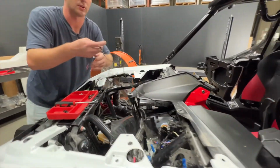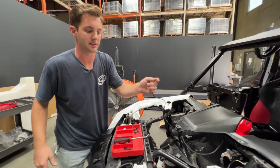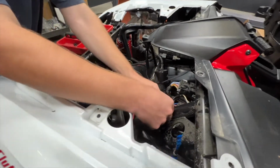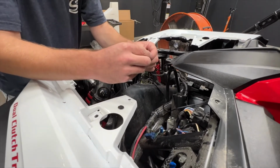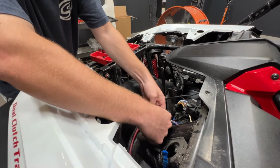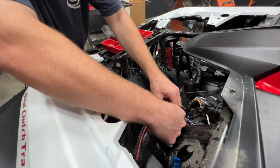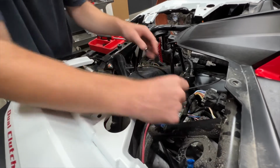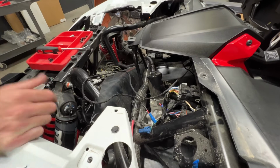And grabbed it out up front here. And so we'll cut and strip this end, and it's now ready to be installed in the posi tap, and I'll show you that here. So we're going to go ahead and remove the top portion of the posi tap, put this around the wire, install this back into there, mush it down a little bit, and then start threading this in to pull that accessory wire tight. All right, and with that tight, we'll just give it a little pull test, and we can continue zip tying our accessory wire out of the way.